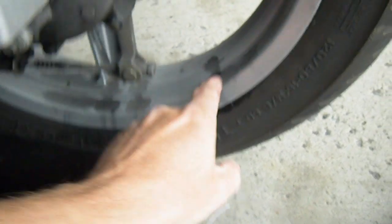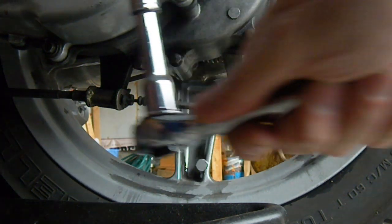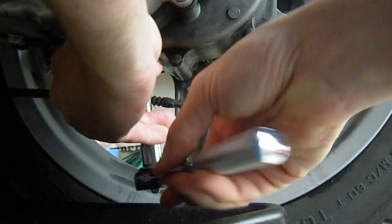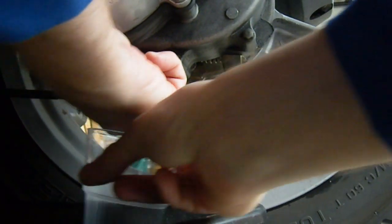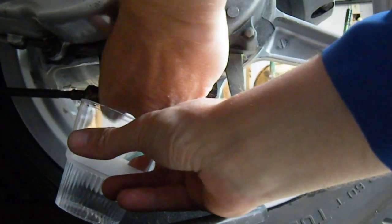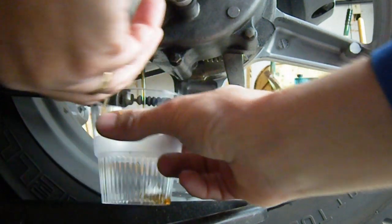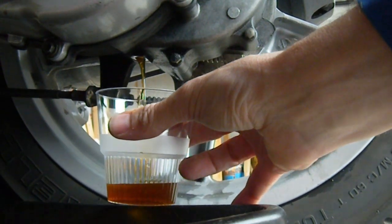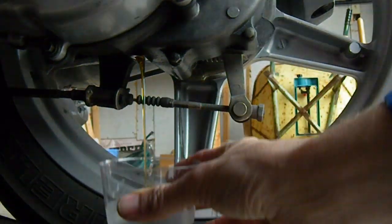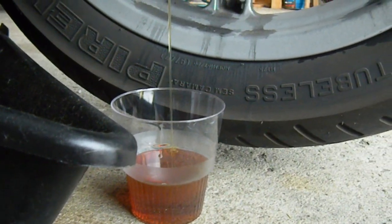The reason I'm catching the oil is I want to measure how much is left, because as you can see, I've got oil dripping out. I'm going to undo the nut on the drain and put the top underneath while I do that. It's going into the cup — I'll be able to measure how much drained oil there is over the course of the year.